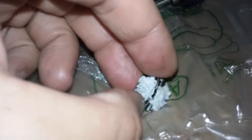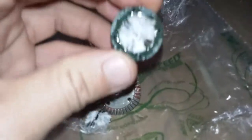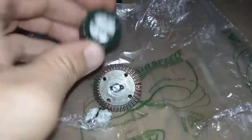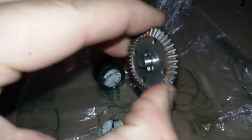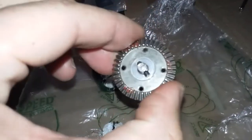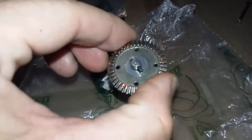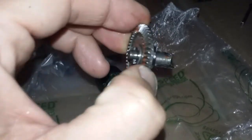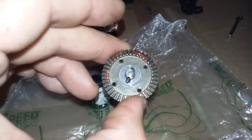There's a little bit of JB weld left over here. The planetary gears are here, all bent from trying to pry it apart — another set of planetary gears, bevel gear, another bevel gear buried inside. The whole thing is trashed. I needed to reuse this ring gear since I didn't order a new ring and pinion gear from Vaterra — I figured the stock one would work for the moment, trying to be budget friendly as possible.